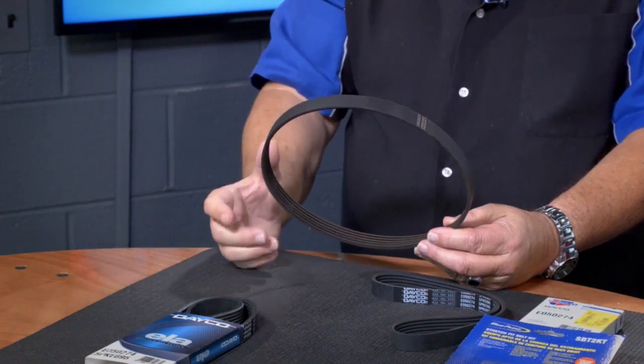So what do you do with them? Typically you use a wrench, take the tension off, take the old belt off, put the new one on, release the wrench so the tension is back on the belt, and you're done.